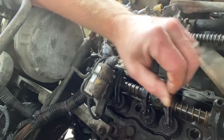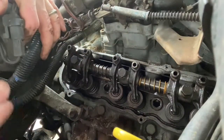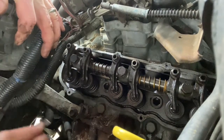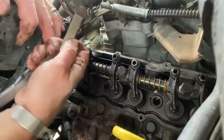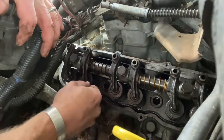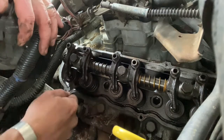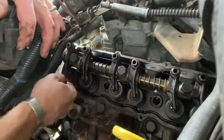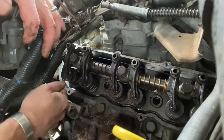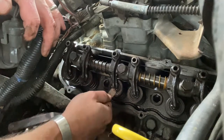That may be normal - we don't know until we check. I looked at the specs: it is 14 to 16 thousandths - 14 intake, 16 exhaust. I'm just doing them all at 15 thousandths feeler gauge. I should be able to slide in here with just some drag. That feels pretty good. This one - maybe a little tight - but we're going to roll the motor and make sure that it's all the way free. Let's check over here.